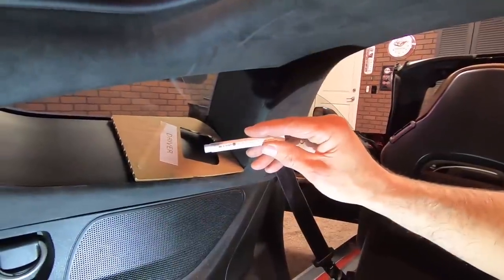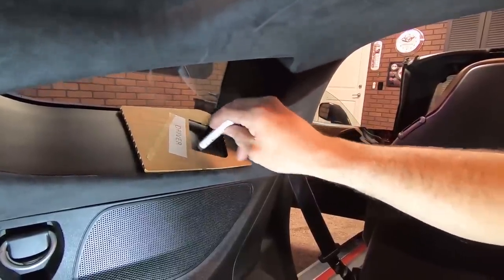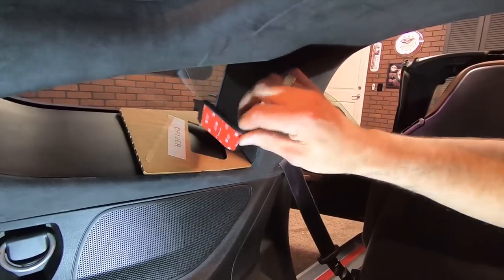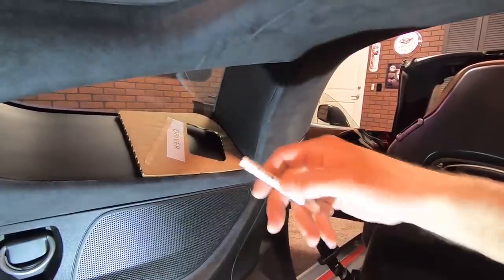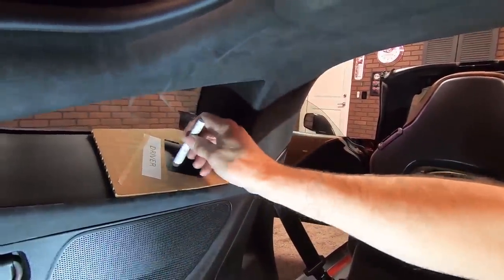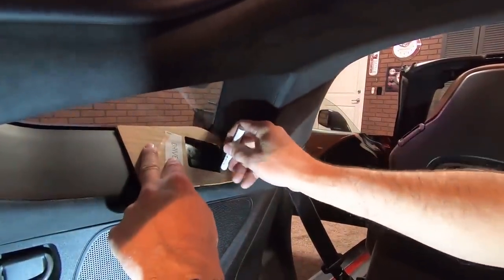Okay, so they supply us with a 3M primer pen, and we're going to use that here inside this cutout area of the template. This makes sure that the adhesive of the bracket itself, which is right here, is going to stick and hold in the windowsill. So you have to press this little black dot right here. You crush that, I don't know if you heard that or not, and at that point it'll start filling the material here, and then you can start painting it on, just like so.